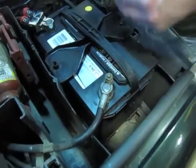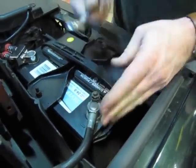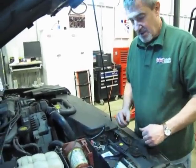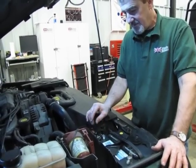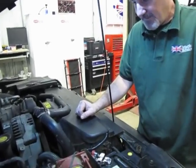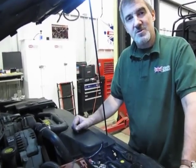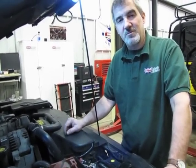Don't be alarmed if you see a tiny little spark when you first connect it — it's just the connection between all the modules. There's always a little bit of parasitic draw, so it's going to happen. Get that good and snug and give it a little wiggle to make sure it's on there good and tight. So we've done a repair on our battery cables, we've got a really good connection on both, and this is something that's going to last for a considerably long period of time. Plus it's rather attractive looking — it's got a nice chrome finish, really nice setup. When you're ready to do a proper repair on your battery cables on your D2, just give a call to any of our knowledgeable salesmen at 1-800-533-2210. Thanks for watching.